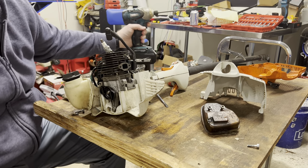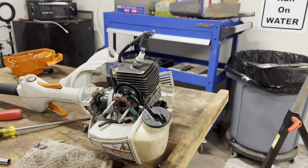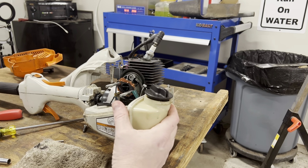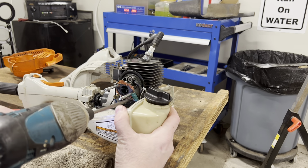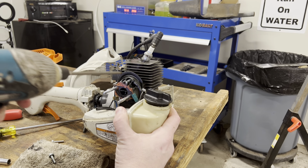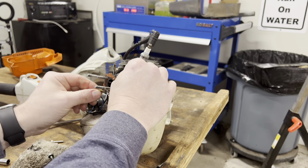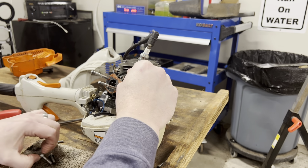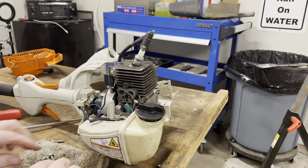Okay. I'll move you over here so you can see. Sorry about that. We have a breather intake that's all set up here, it's all for the intake. Screws there. It just comes up. And then this is your kill wire circuit that allows you to flip the switch and kill the engine. That grounds out the engine. So we'll put all that over there by the cylinder.